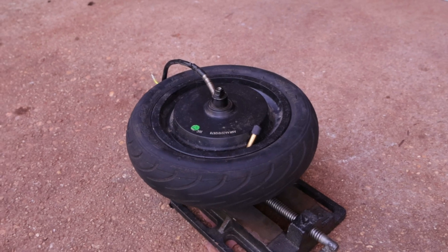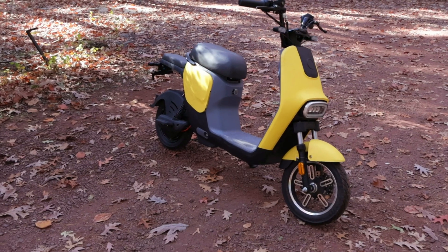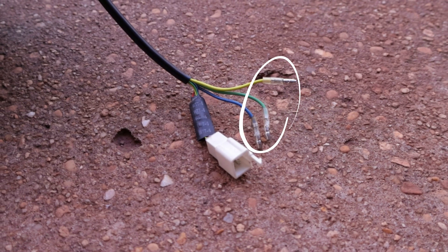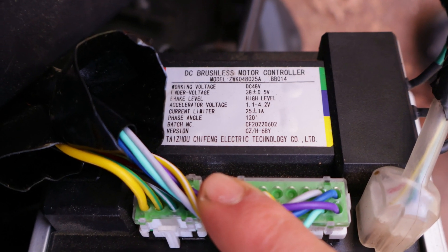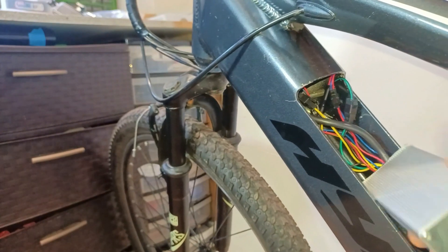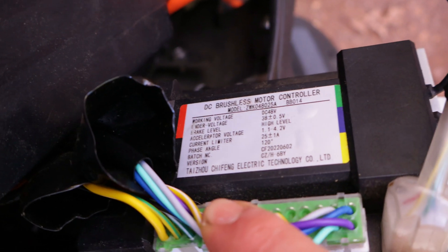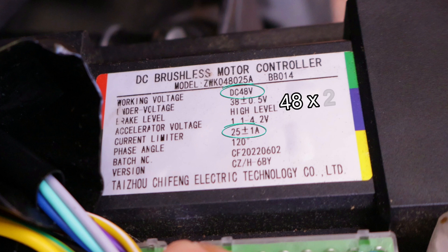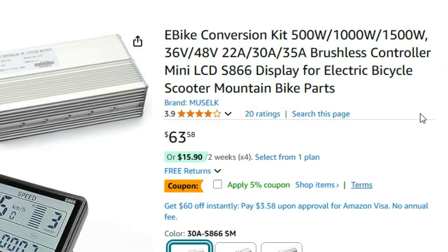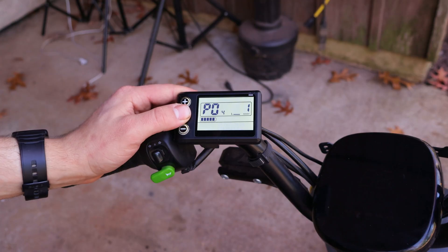Next up, we have the motor. It does not matter what motor you're installing this controller on, as long as it is a brushless motor — which means it has 3 thick wires, a cable of at least 5 thin wires, and has the same voltage and wattage as the motor controller. For example, most budget e-bikes are rated for 250 watts with a nominal battery voltage of 36 volts, so you'd need a matching 36-volt, 250-watt controller. In this case, where we have a motor controller rated at 48 volts and 25 amps, doing the math gives us a total of 1,200 watts peak. So for the moped, I got a 1,500-watt controller, which is a little higher but can later be limited through the display.